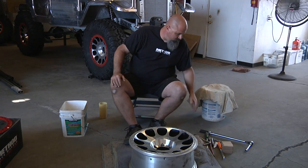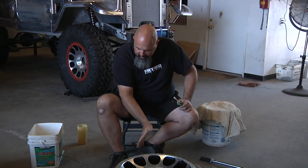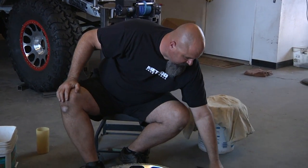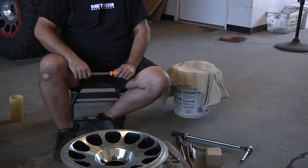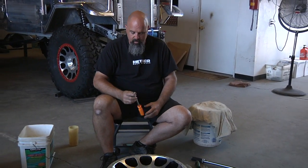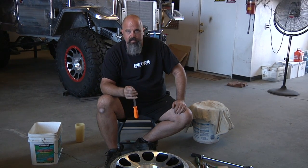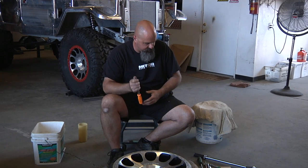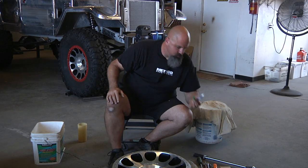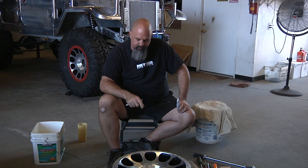Tools you need — pretty simple. We've got socket and ratchet. A screwdriver — you'll need this, along with some kind of pry tool to get the bead set back down in. We put a little tape on the screwdriver to keep from nicking the wheel. Torque wrench — we'll torque these wheels down to 20 pounds all the way around. It takes a little while because you've got 36 bolts. The one special tool you're going to need — you can usually pick this up from any tool distributor, Sears, any hardware store — it's a valve stem installer. All you do is screw it on the valve stem and pop the valve stem in. A Sharpie marker to mark your bolts, and some anti-seize. You want to make sure and put a little anti-seize on every one of these bolts.